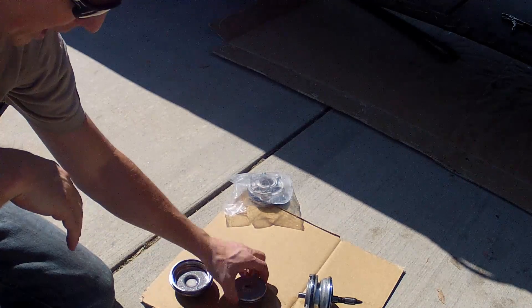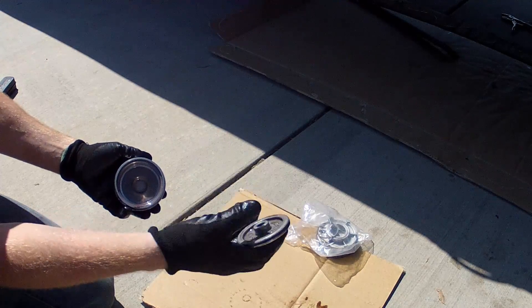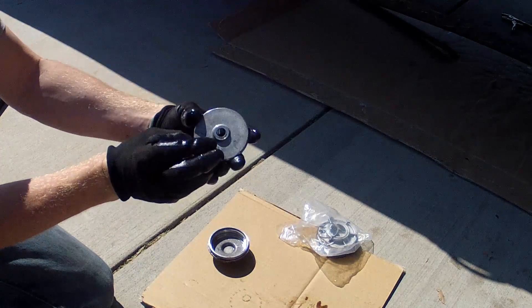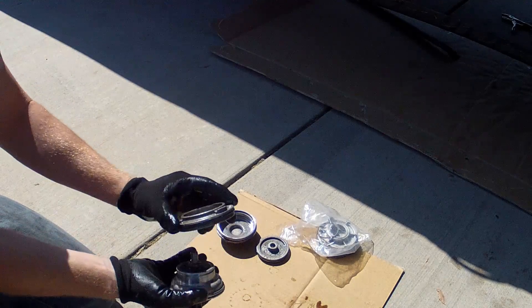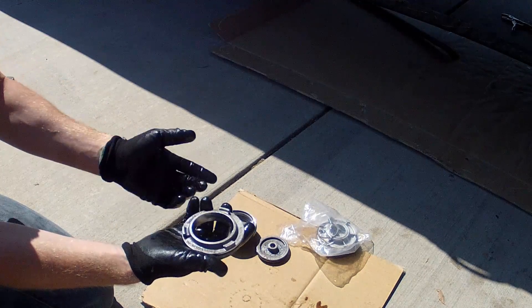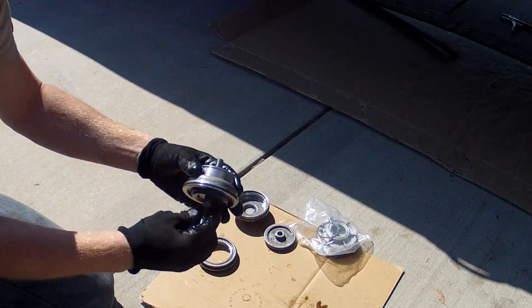Watch for the ATF fluid. I finally got this thing out. It sits in the transmission like this — this is the outer housing. There's this piece that you're going to reuse; make sure you put it back in the same way. One end sticks out a little bit farther than the other — the part that sticks out just lays in there like that. This other piece will be changed. Remember that these little flanges go on the outside. On this piece there's a spring that we'll have to take off — there's a little snap ring holding it in — and then the shaft comes out.